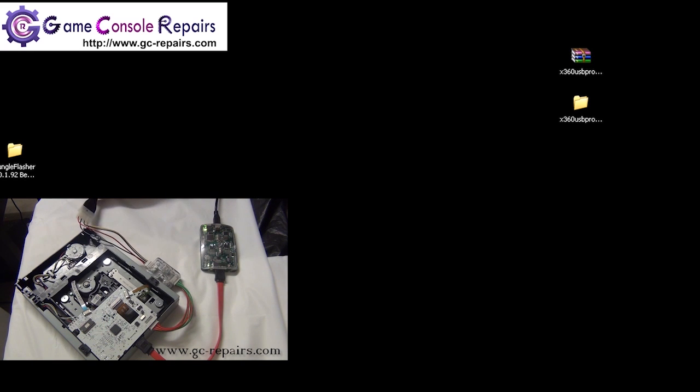CK3 mini does come with USB to Molex power supply, which is more than enough to supply power source to a DVD drive. However, if you plan on ejecting the drive, you need at least 12 volts, so you need to either supply external power source, or you can use PC power supply. In this case I'm using external power source anyway, just in case.